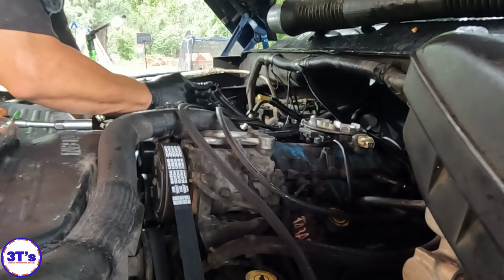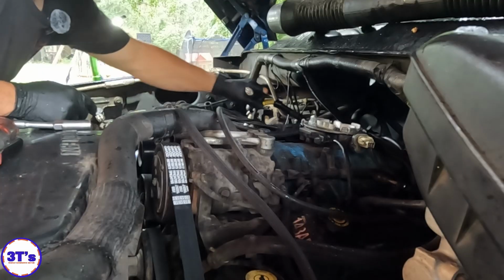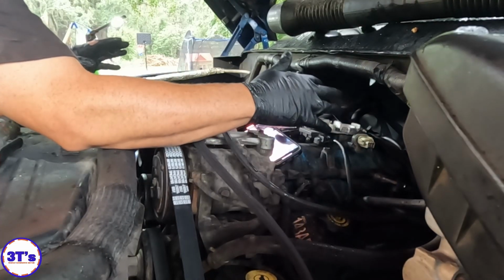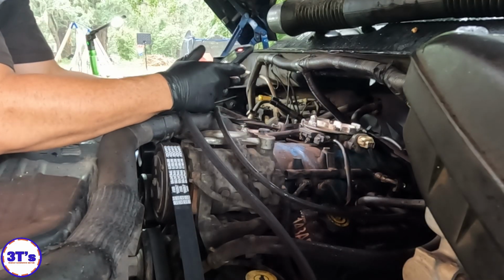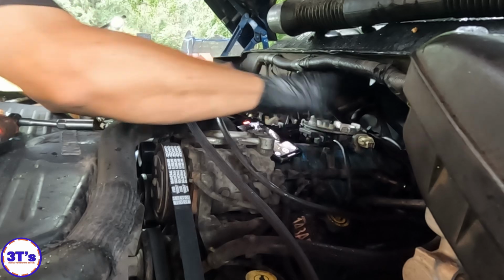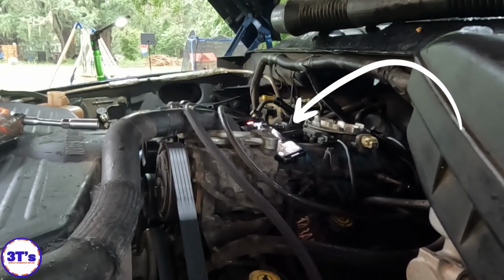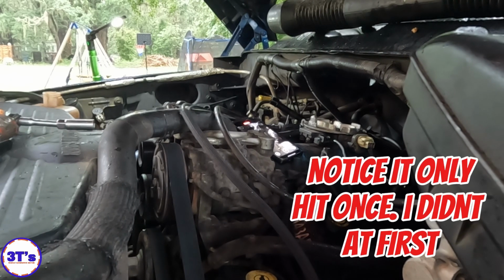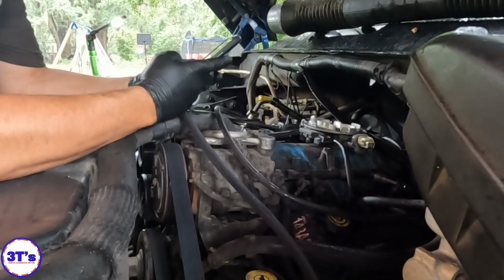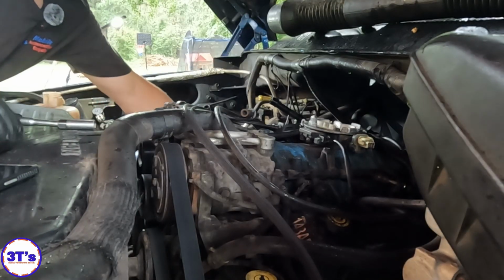Let's plug it in here. And let's find a way to put this somewhere without starting a fire. Why is the flash on? All right, let's see if we got spark on that spark plug. Well, I can hear the difference in compression big time on that one. Well, that's got a ton of spark on it. Let's check the rest of them, because something's not right here.